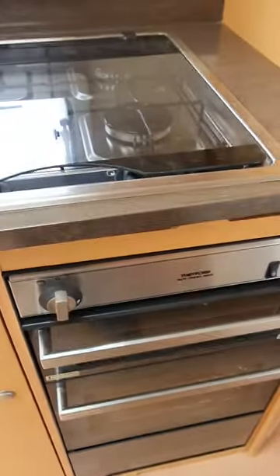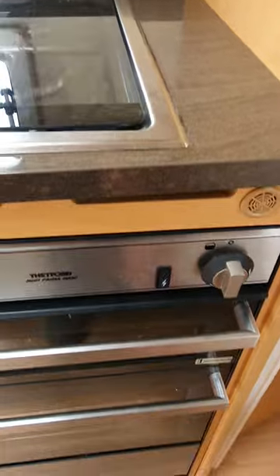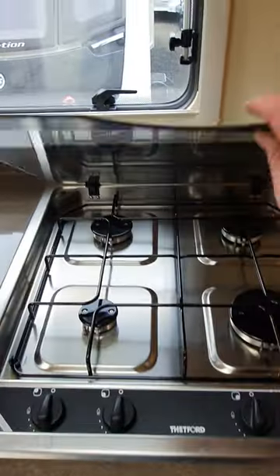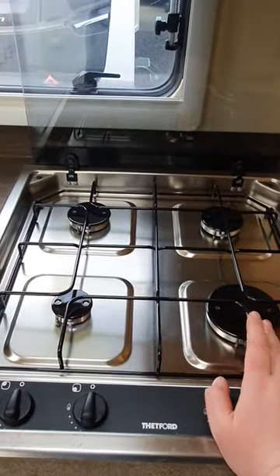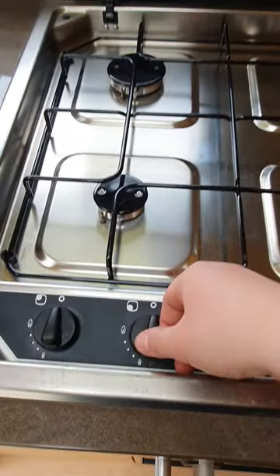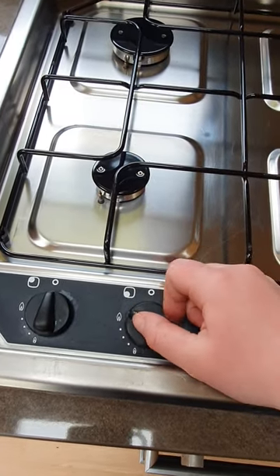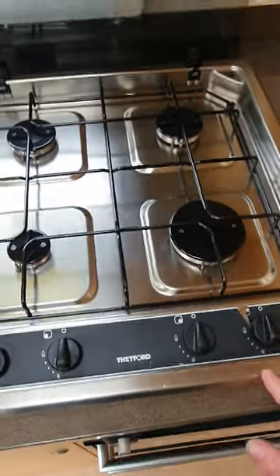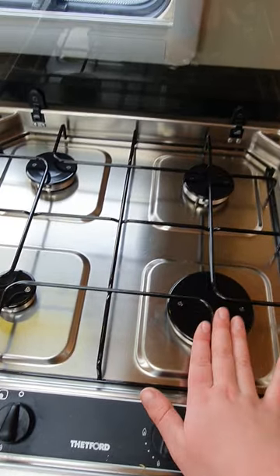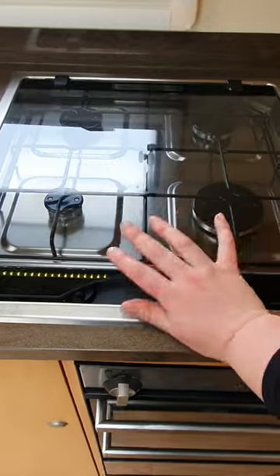Here we have your elements, your grill and your oven. There is an igniter on the front of your oven here — that ignites the oven, the grill and the elements. Up the top you want to push that glass back as far as it'll go. You've got four elements and they all run off gas. Very much like a barbecue, you're going to push, turn and hold at the highest flame, hit that igniter on the front of the oven, and then once it's lit you can adjust your temperature from there and back to the zero for off. You've got two controls on each side. When you're finished using these elements it's really important that you make sure they and the little wires are cool to the touch, because if you put that glass down when it's still hot it will shatter the glass.